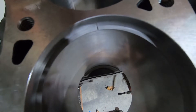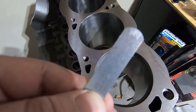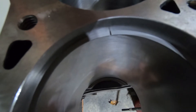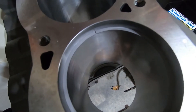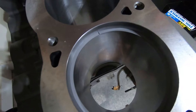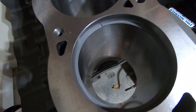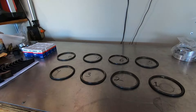The first ring is done — only took about 20 minutes. There's our 27 thousandths gap, confirmed with a feeler gauge: 25 plus a 2 behind it goes in there perfectly. This is a very tedious process but if you take your time it'll be done right. Now it's time to repeat this times eight cylinders.